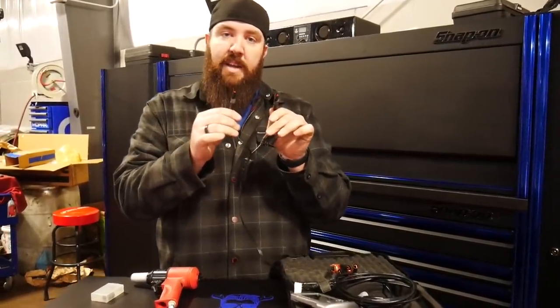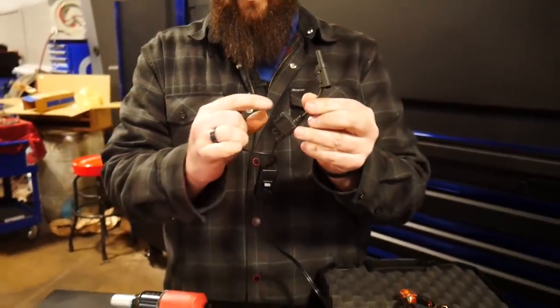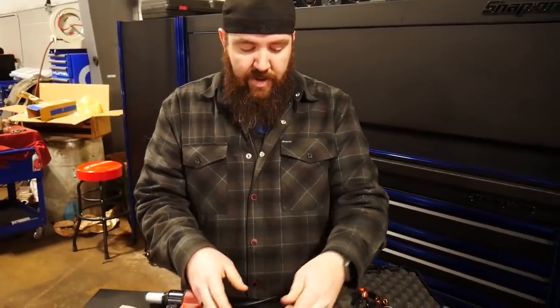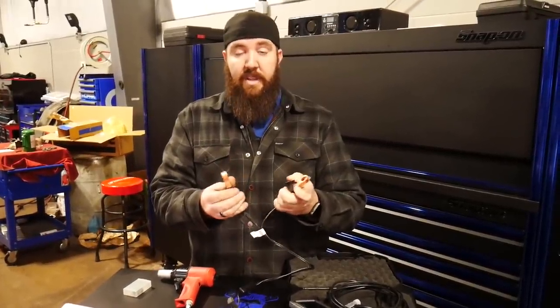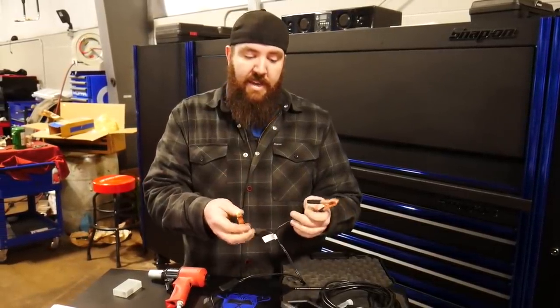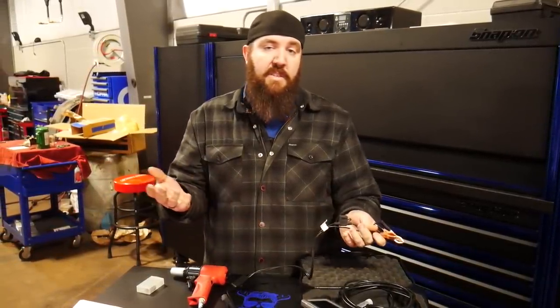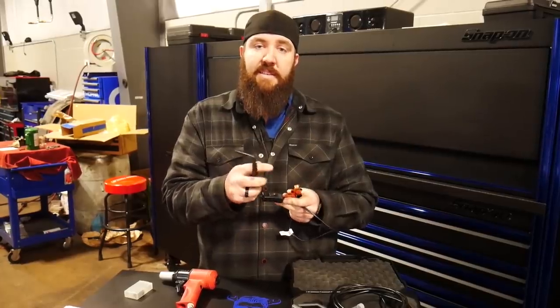It has nice banana clip style test lead ends that go into a standard meter — able to go into positive, which is fused right here for you. It has a nice 10 amp fuse, goes into your meter on either end, and then you take off your negative battery clamp, clamp the positive, clamp the negative — or clamp either end to the cable and the battery respectively — also fused on this end as well. When you plug it in, it puts power through from one clamp to the other so it's like the battery was never unhooked. When you're ready for the power to feed through the amperage side of your meter, there's a nice switch — flip it and it goes from being bypassed to going through your meter to test for that drain.